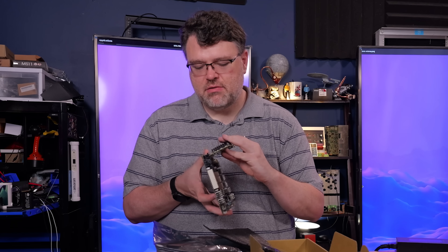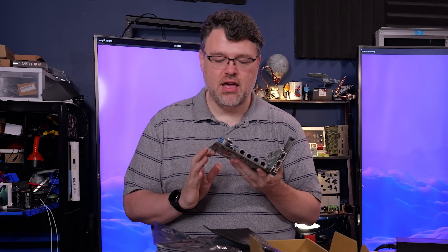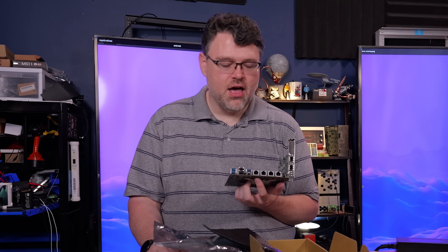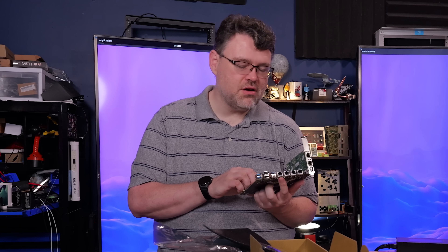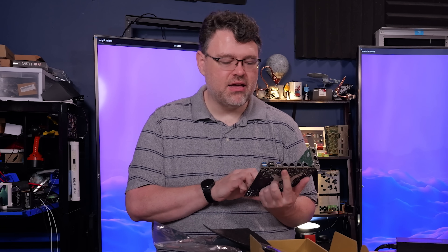You've got an expansion slot, so we'll be doing exotic things. I've got my Mellanox Connect X5 here, which is dual 25 gig. In this configuration, we've got four 2.5 gig plus dual 25 gig. This will rock your world for building a stateful packet inspection firewall that runs at wire-speed 2.5 gig. Plus you've got the modern Zen 4 cores, so you get all that VPN acceleration — WireGuard or OpenVPN packet acceleration goodness.